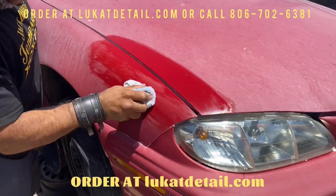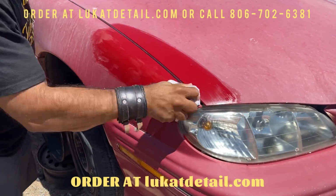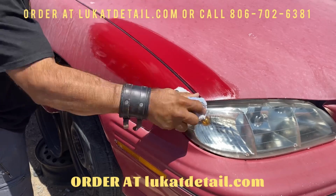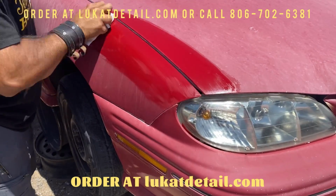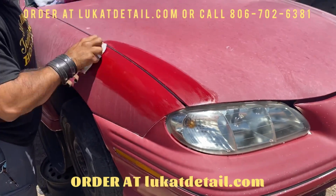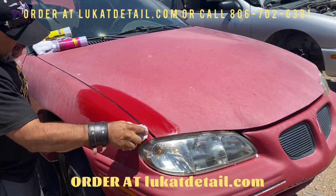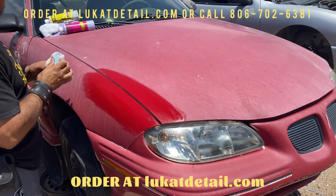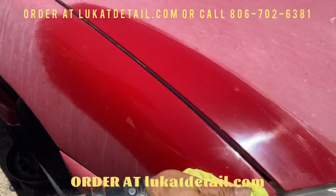If your paint job is a newer paint job with a clear coat and it's hazing up and it looks good when it's wet, dries up, gets ugly again, even for 2 seconds, that means your paint job is still in good shape. You want to clean it. There's still a lot of clear on there. And that'll neutralize and stop any erosion or peeling or delamination, whatever they call it. You put this on, this cleans, okay? Now we are going to put a wax on here to protect it, but it's not a regular wax.